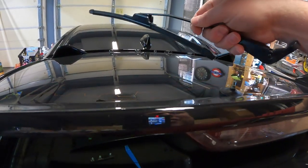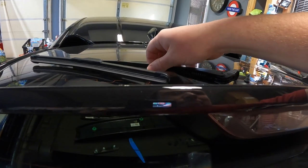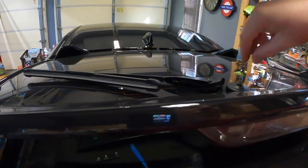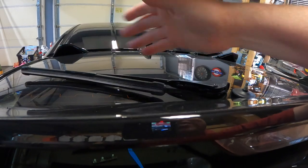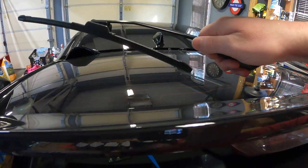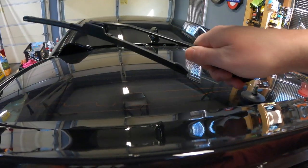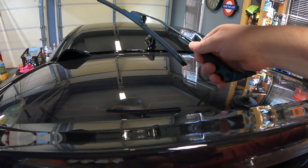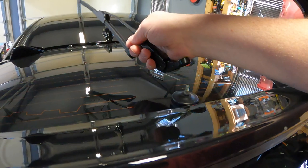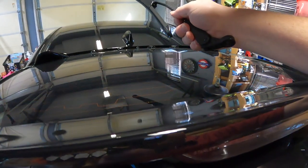So what you've got to do — it's stuck in this position because of the axle that the wiper rides on. If you kind of lift it up — remember when you lift this you're going to bang it into the wing, so be careful. Just lift it up as much as you can, wiggle it to get it off that pressed-on piece, then you can stand the arm up and once you do that you should be able to lift it right off, no problem.